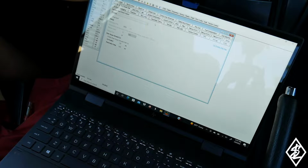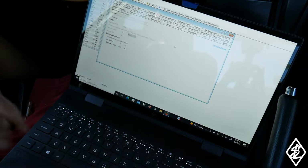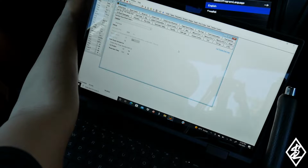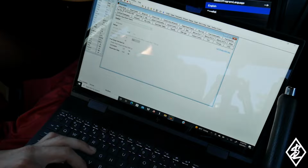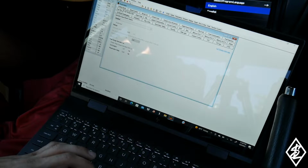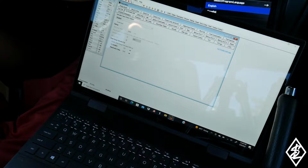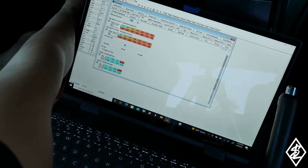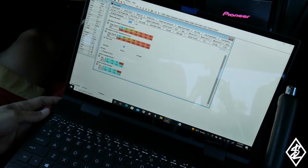And really, I believe we're ready to just upload this into the ECU, into the Hondata. So let me go ahead and just turn on the key here. Okay, there we go. It's on now. The little arrow is here, and I could update the changes to the ECU that I just made here. There it goes. It's already been updated. I guess we're going to go ahead and do a cold start. Okay, that's a smooth start there. I'm not giving it no gas.